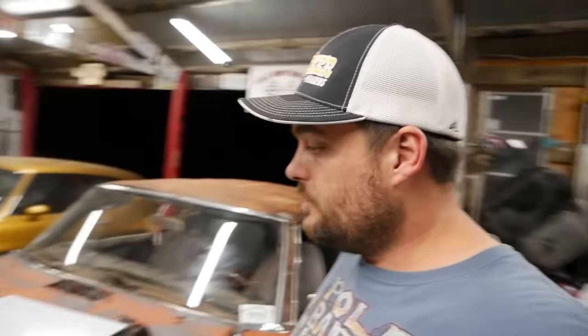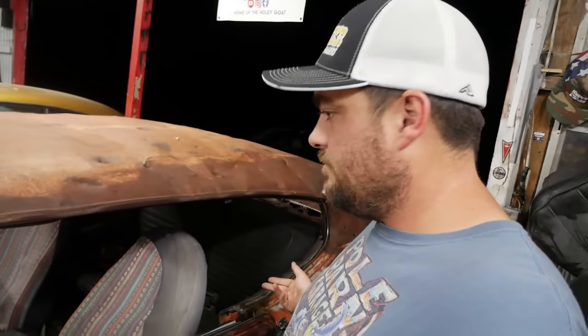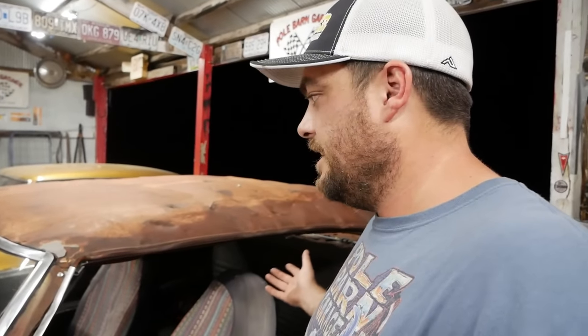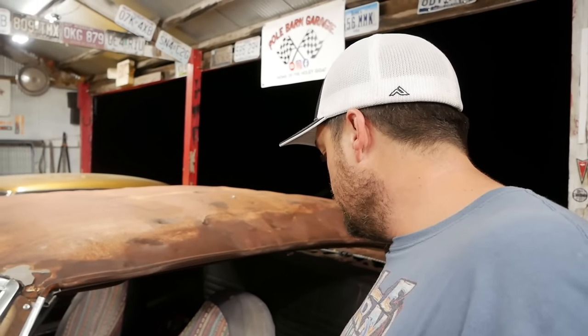Since I screwed up the windshield wiper motor, let's see if I can screw up the windows too. I got some polycarbonate sheeting here — not plexiglass, it's polycarbonate like Lexan. It doesn't break off into chunks — acrylic is the dangerous one. This is legal for racing. All I'm going to try to do is cut a window-shaped piece of polycarbonate and just let it slide up and down in the window channel. I'll take a measurement from where the original window is — it doesn't have to be perfect, just something so I can go down the track.